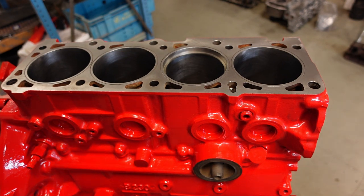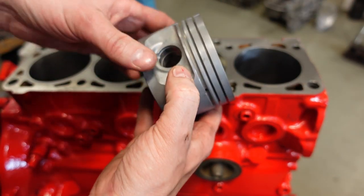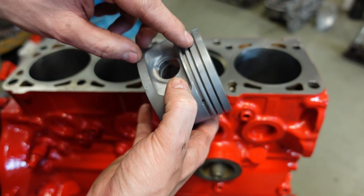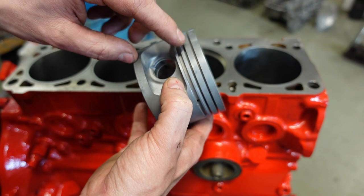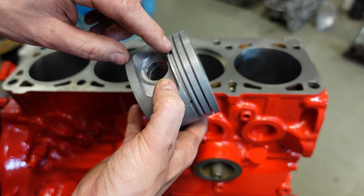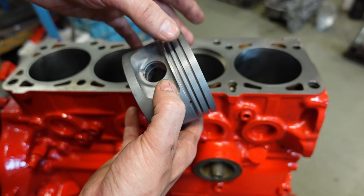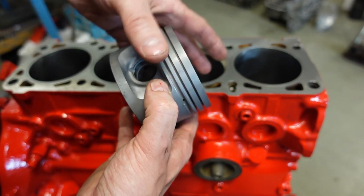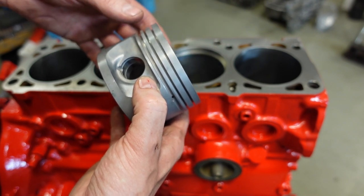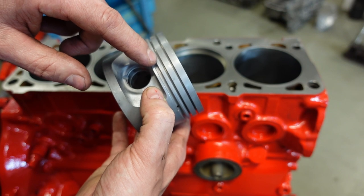If the other rings come in around 0.58mm I'll leave them as-is on the top ring. The second ring I'll open up slightly - about 0.05mm more than the top ring, so around 0.60-0.65mm. This is because if you get compression trapped between the rings, it forces the top compression ring up and unseats it from the cylinder wall. Adding 0.05mm to the second ring gap prevents this problem.